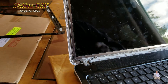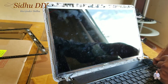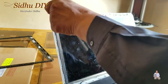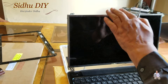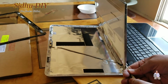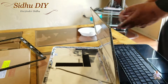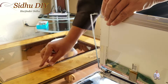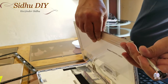In order to remove the screen, we're going to remove six screws. After removing all six screws, the bottom portion comes out. On the side there is one screw here and one screw on the other side — we're going to remove those, which hold the screen in place. And one on the top. It's important that we take the bottom screws off first. Make sure you don't lose the screws — these are really tiny screws.